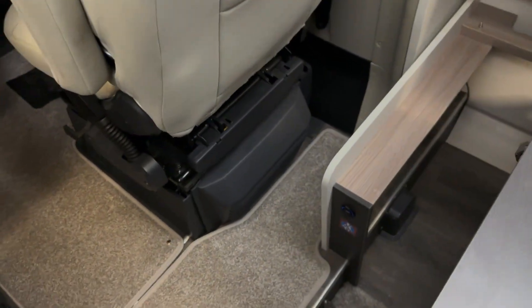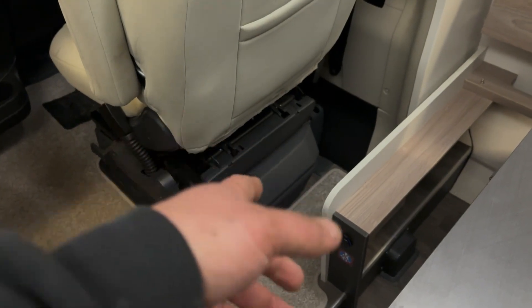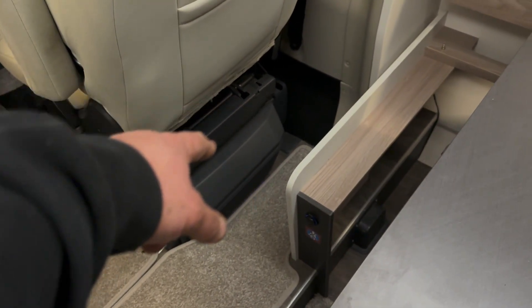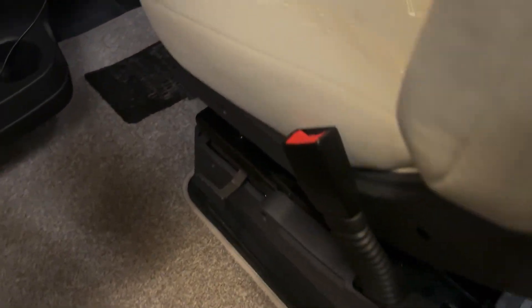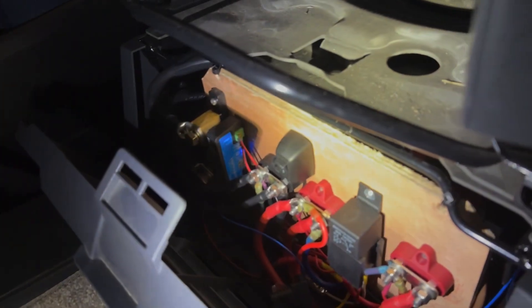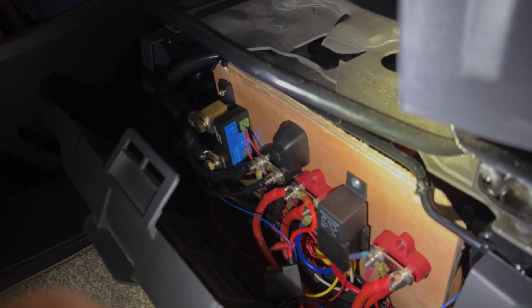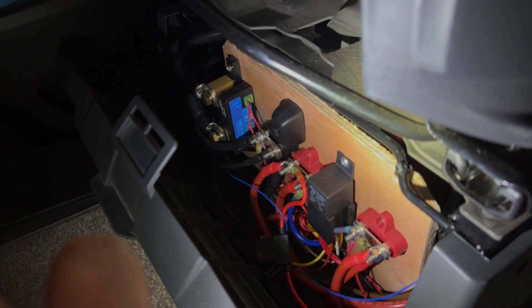The cables then run under the seat, which is where the battery lives. From factory, the AGM battery comes underneath the seat. We take the seat off, remove that battery, and the biggest battery we can fit under there is a 300 amp-hour lithium — the Fogstar 300. We always mount components on the back of the seats. On this install, we have the MPPT and the Orion behind the back cover. On the front of the seat, we have the shunt, the relay we use to disable the split charge and the Sargent, some busbar distribution, and the Cerbo switch mounted on the board — with the Cerbo itself mounted on the back. It's a pretty busy under-seat setup, but it works well and makes good use of the space.